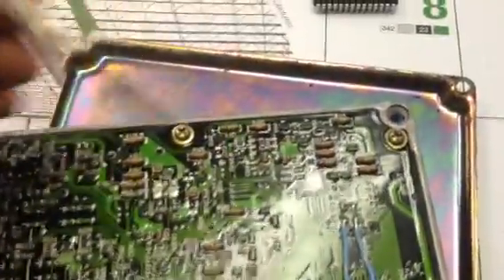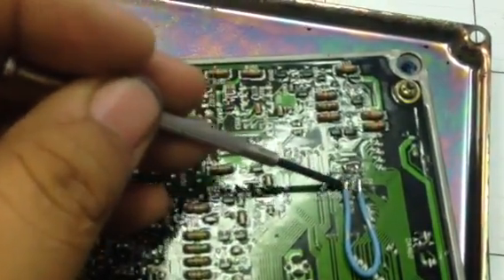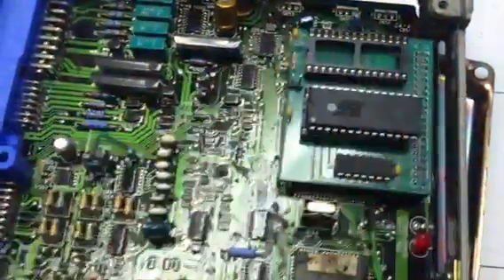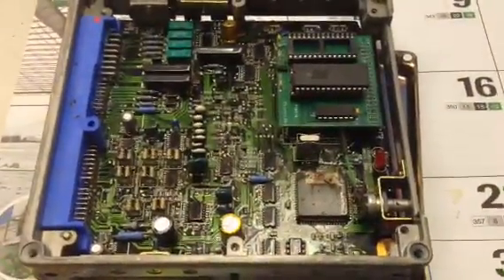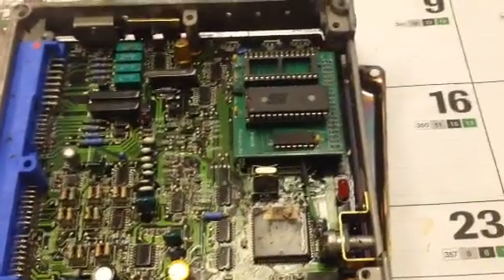You solder CJ1 to 2, or CJ1 to 1 right here, just looping down. Once that's soldered together, you can put your chips in and your ECU is good to go. I am using a 26 ECU, which is a 91 or 92 Nissan 240SX Dual Cam. That's in place — ready to go.